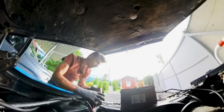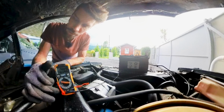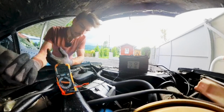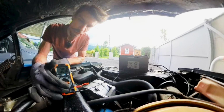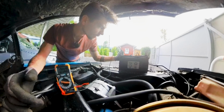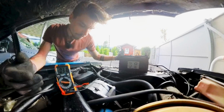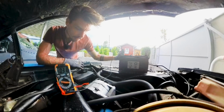And I did. And this is what my multimeter says. So the positive side, 10 amp side, goes straight to my starter cable, which is the switch side on my magnetic relay. And this side goes to the positive terminal on my battery. And now, see, 0.3 amps. I always hit a reading of almost about 0.9 amps. And I kept testing and testing and couldn't find the cause.